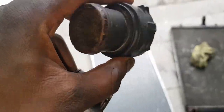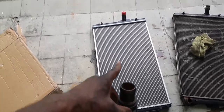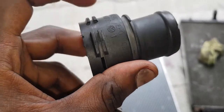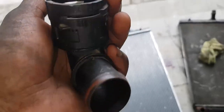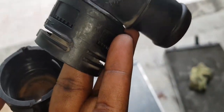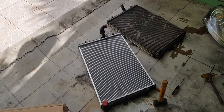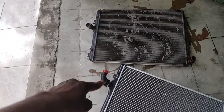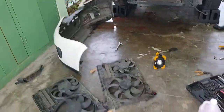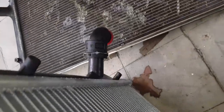When fitting the connections, be sure of orientation: this is the top of the radiator, this is the base. This side goes to the vehicle's left, that side to the vehicle's right. The top connection should face up so you can put the metal clip on top, and this one should point down on the other side. I've lubricated it with coolant before fitting.